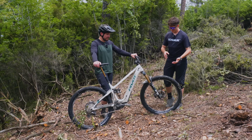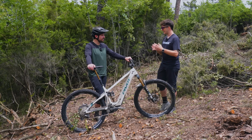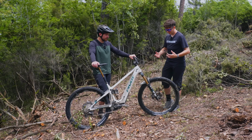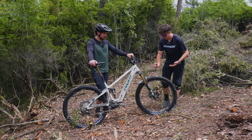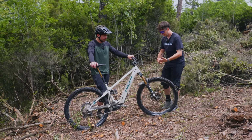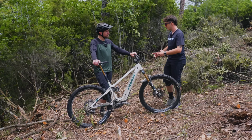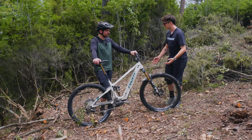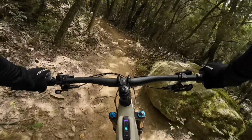We have. And with the Albert, we've basically designed the whole tread pattern to work best with the radial casing technology. The approach we took was a high surface design, which means large knobs and a lot of them, a short pitch, a lot of repetitions. Because of the increased contact patch, there are more knobs on the ground all the time, which means more grip, more control, and on top of that, less rolling resistance, because there's less deformation in the casing. It's more support from the knobs. Okay.